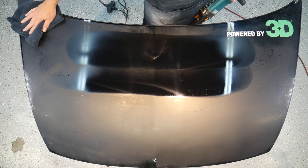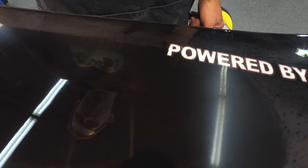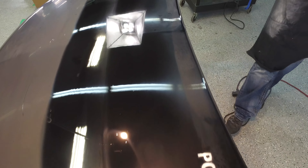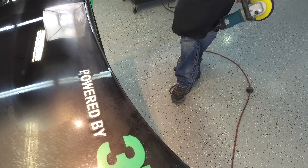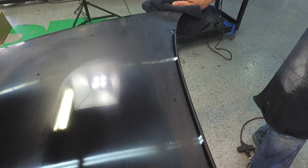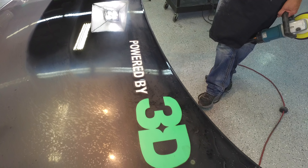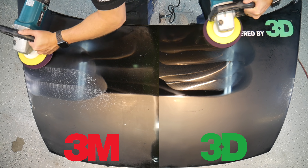Let's not be fooled — ACA 500 is a pretty impressive product in and of itself. But you can see there is a little difference, and we hope you take the time to do this challenge on your own. Now we're going to show 3D versus 3M: the whole 3M system — chemical and sandpaper — versus the 3D system — chemical and sandpaper. We're going to use the same foam pads just to show chemical versus chemical, paper versus paper. We're speeding this up so you can see the difference and maybe decide what you'd like to do in your shop.